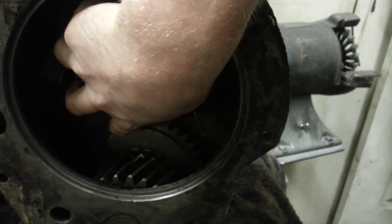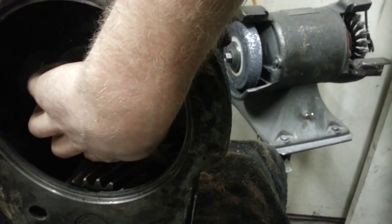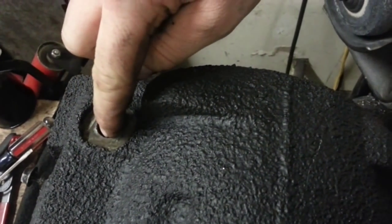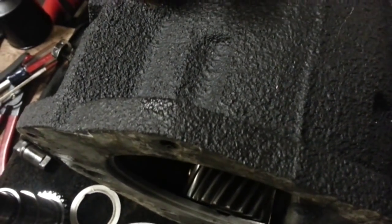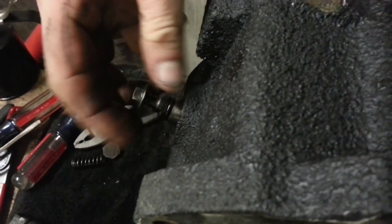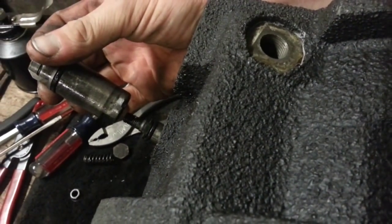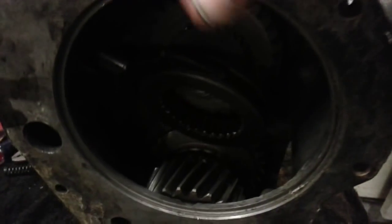The easier way to do it: take this little nut that's on the top of your 203 transfer case and take that off. There is a spring in there, so you decompress that spring and pop it out with a screwdriver. Take that spring out, then there is this little shift piece — take that nut off. This little sleeve was in there, so you take that shift fork out.